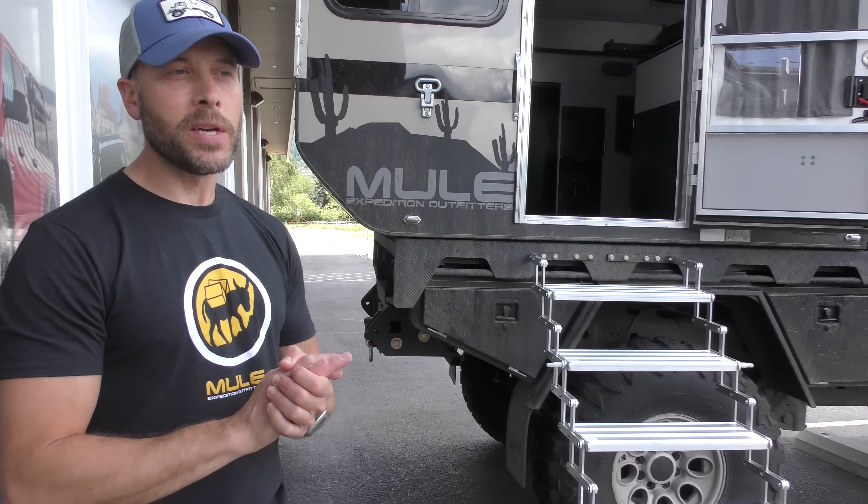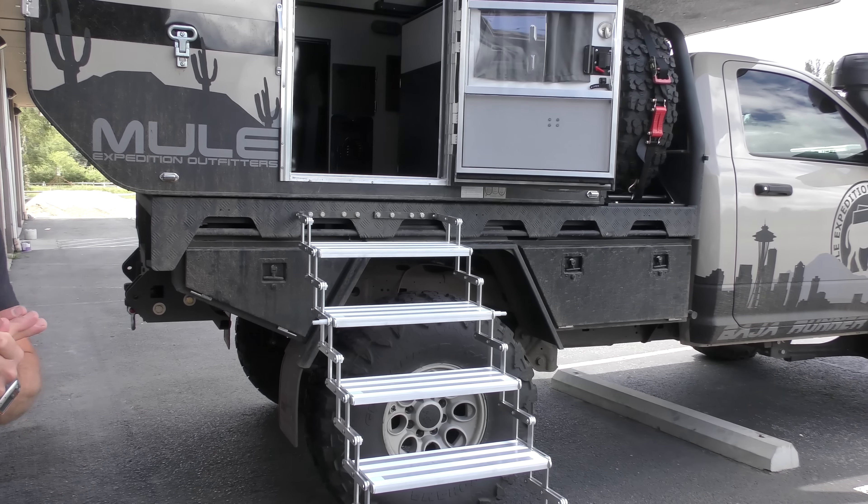What we're using is a mix centered around AEV's 3-inch lift kit. We did pass on the Bilstein 2.0 emulsion shocks that come with the kit. Given the amount of weight we're carrying and the places we're going to take the truck, we felt it would be better suited to have a remote reservoir to keep nitrogen and oil separate, so you don't get suspension fade on washboard roads. We also went to a 2.5-inch shock body so we could run a larger shaft — extra beefy because there's a lot of weight on the rig and you don't know how you're going to be loading those shocks off-road. ADS custom made us a set of pin-top piggyback 2.5 remote-reservoir shocks.